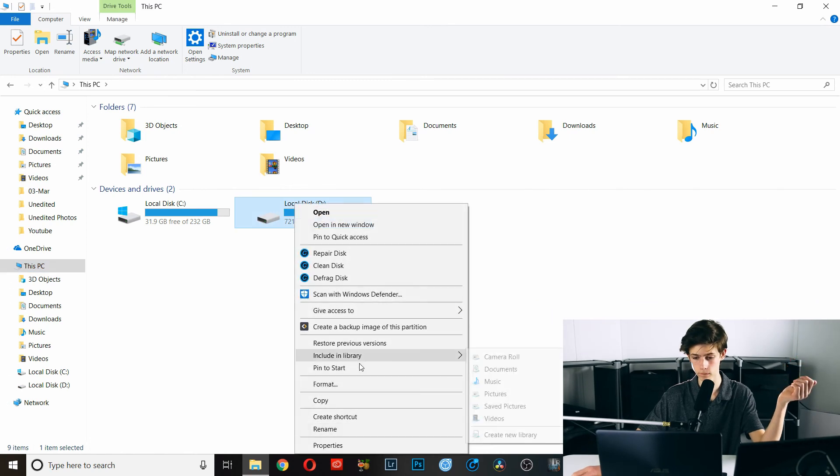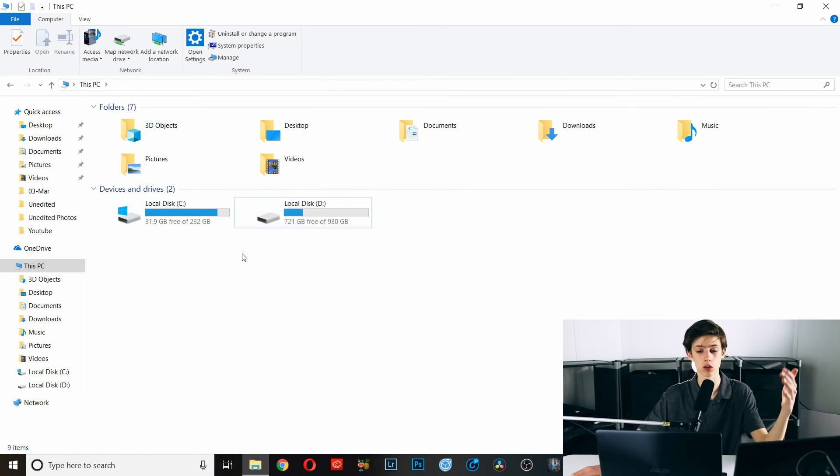If your SSD is running properly and you don't need the files on your hard drive, you can go ahead and reformat it so there isn't any conflict between files, then move your files from the SSD over to the hard drive. Simply right-click on your hard drive, click Format, and follow the on-screen instructions. As long as you have your data backed up and the SSD is working properly, there is no risk in formatting your hard drive from Windows — as long as you don't shut it down mid-process. That concludes it — please like and subscribe, and I hope your computer is running faster now.